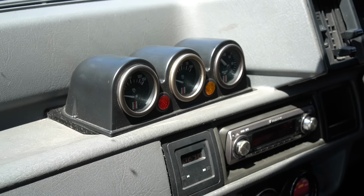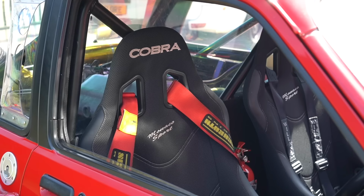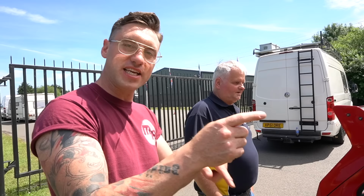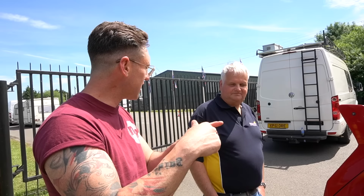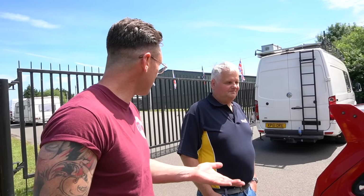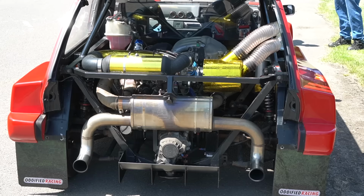Right, right. For those of you out there who build your own stuff, the tenacity and the patience that Ian has had with this car. The clocks look like Metro clocks, but actually it's 3 different clocks that have been made, even down to the speedo. They would have had a cable speedo, so he's used an electronic pickup and an LDV electronic motor for the back of the speedo and then calibrated it so that it still works at the right speed, but still looks the same. Off the ABS ring on the front wheel. It's just that sort of stuff people don't do. People ignore that sort of stuff because it's easy to ignore it.